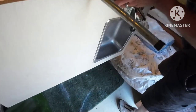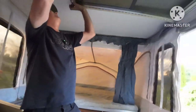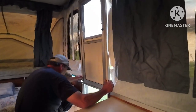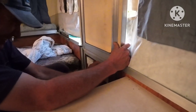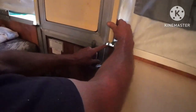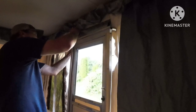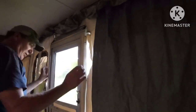Then you press and hook it in the ceiling — this flips up. Our door has to come down; it stores in the ceiling. You turn these two things here like so — that lets your door down, you drop it like this. It fits in these two little grooves right here; you have to shut this door first, line it up, and it also latches here. Our cables might be a little out of adjustment because if you look here our door is sitting tall and it shouldn't be technically. You're supposed to be able to push this down and turn this, but ours just from being old and the wear on it, it's getting pretty weak.